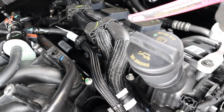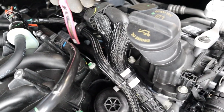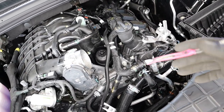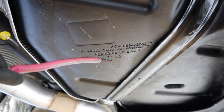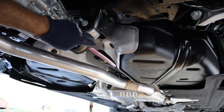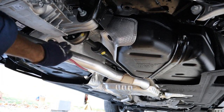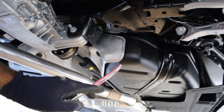There isn't much to see for the fueling system because it only has port injection, but one thing I don't like is this plastic fuel rail with the barcode on it — it runs the length of the engine to power both banks of cylinders. I don't like the plastic, but even Toyota is doing it too so it's just an industry thing. Looking underneath the vehicle, the fuel tank is made of plastic. Unlike a lot of other vehicles where the rear subframe integrates the fuel tank and you have to drop the whole thing, at least on this one they've cleared room so the fuel tank can be dropped down. There are two fuel pumps inside — one for each side — so if you need to service them you've got to drop the entire tank along with the exhaust and the driveshaft. Not an easy job — I wish they made access ports from above, especially this being a unibody vehicle.